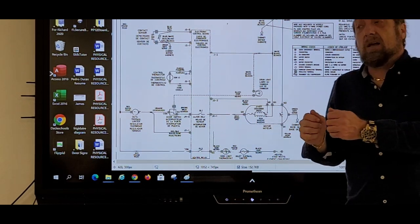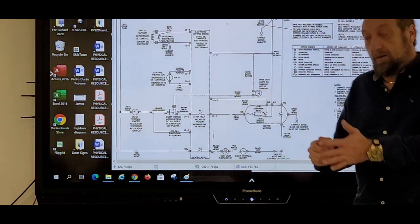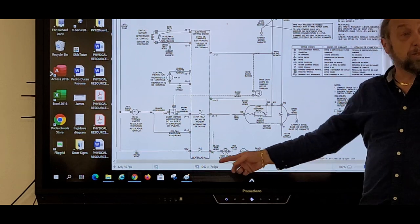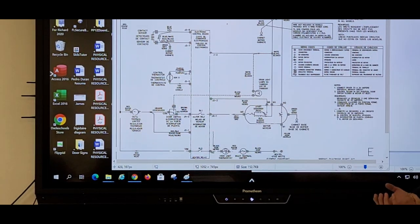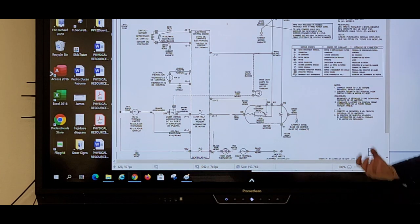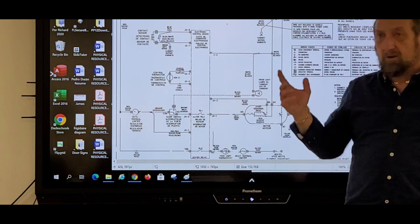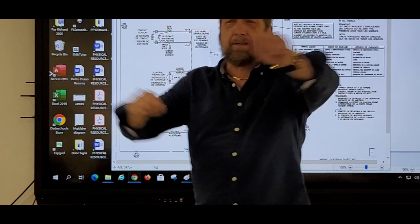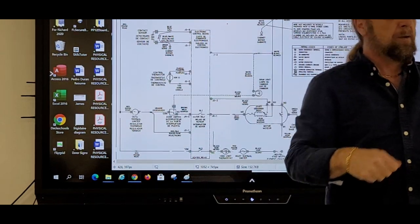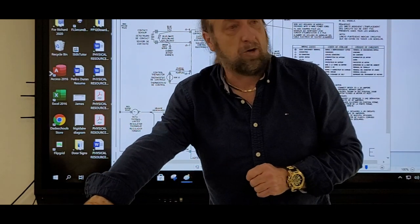If I don't have voltage on that step, it could be a fuse or thermal limiter somewhere in the circuit or the board. That voltage is not getting to that part. But part of the diagnostics, a lot of you guys started going through diagnostics and you're like, oh yeah, I'm doing diagnostics. Look, the pump's draining, the machine's spinning, the diagnostics are great. But the diagnostics are also there to energize that component.